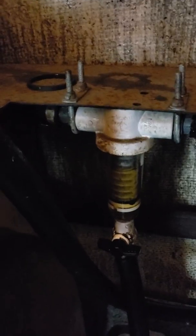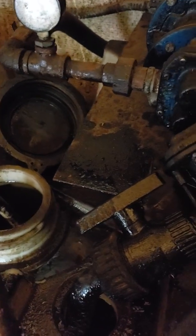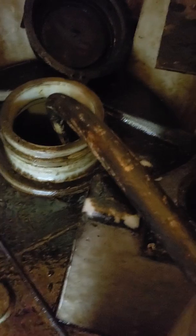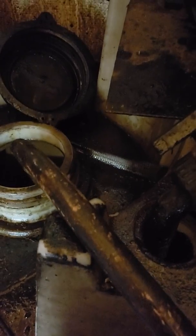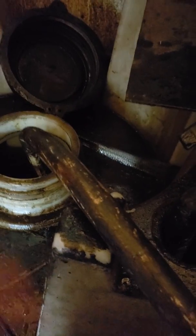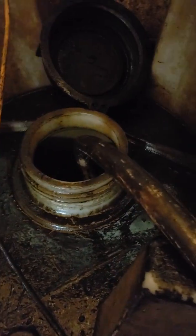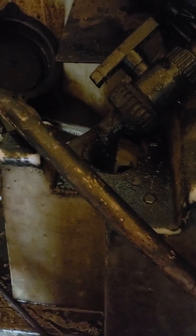Now here soon, this whole tank system back here will be a heated tank heated off my truck — a two-tank setup. The outside tank will have diesel fuel in it. I'll start the truck on that, let it warm up, it'll pump antifreeze through this tank heating the oil through a secondary pipe system. Then I'll flip a switch and it'll pump oil directly from this to the motor, all heated. But I haven't had to do that yet — I've been doing this for about 11 or 12 years and still haven't needed it.